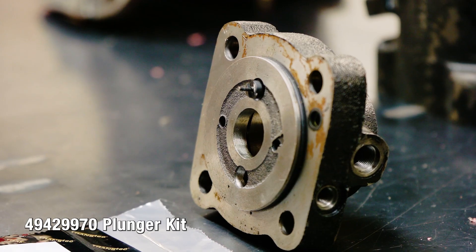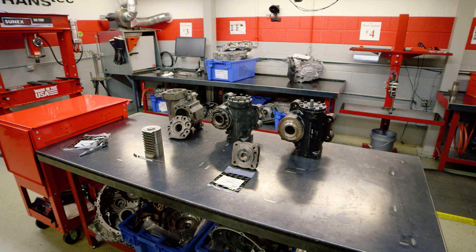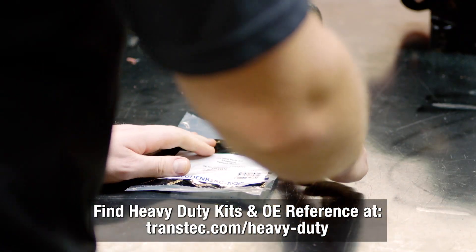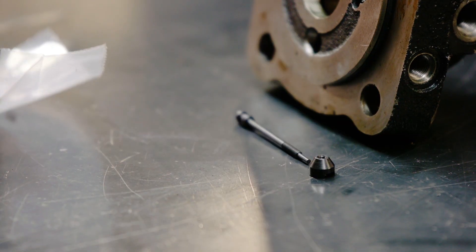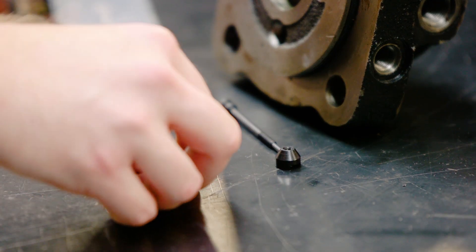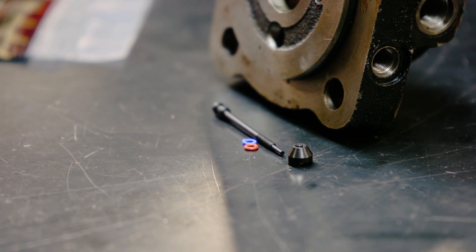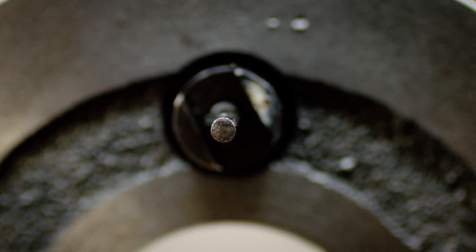If visible wear or damage is present on the plunger, replace the auto plunger following the service manual procedure. Use red Loctite or equivalent on the threads during installation. Be sure to avoid gouging or otherwise damaging the plunger bore during installation or a leak may result. Coat the O-ring of the plunger assembly with a light coat of grease to aid in installation. Do not bend or otherwise damage the plunger while staking the threads — steering gear leaks or damage may result.